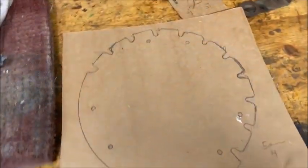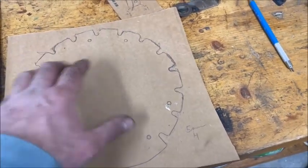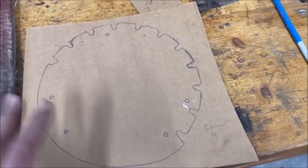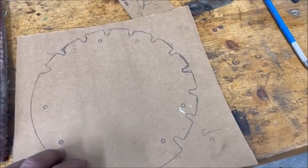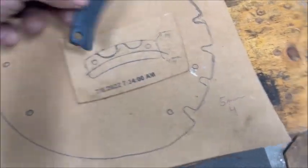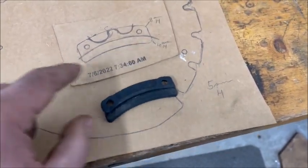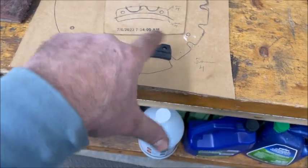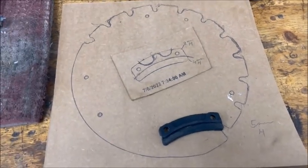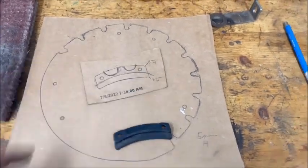Here's the drawing for the chute. I'm going to find the center with a compass, draw a circle to determine the diameter, and then approximate the hole locations. I'll print a one-millimeter-thick template first just to see if it matches when held up against the snowblower. I also took measurements on the mounting block: it's 4 mm thick on one side and 8 mm on the other. Once I know the radius I can reproduce everything in Tinkercad.